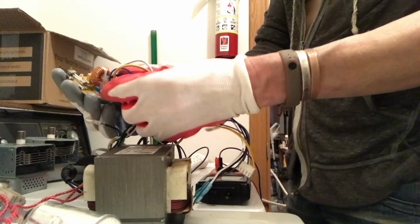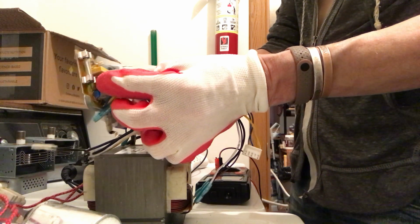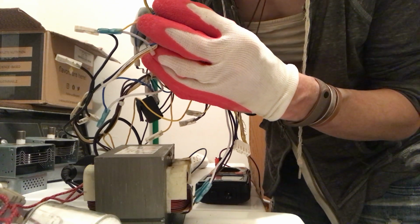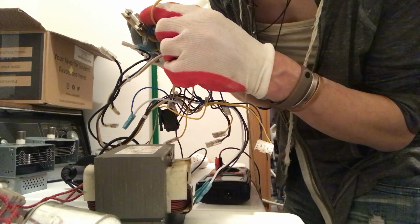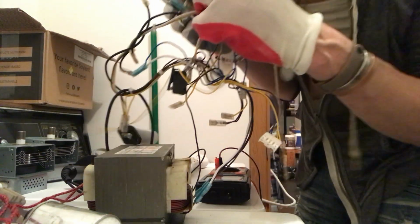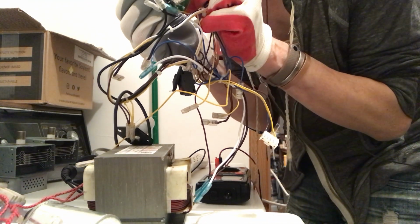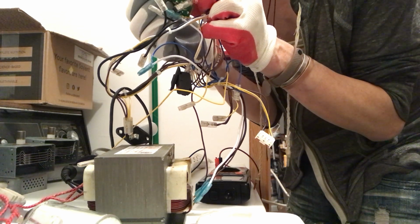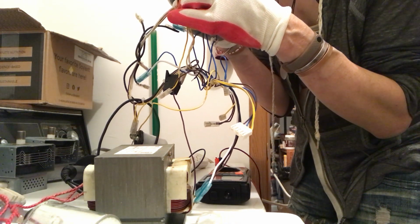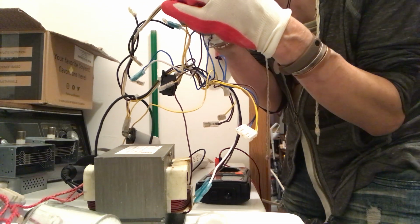And then here we have the fuse, a capacitor, an inductor, a film capacitor, and an R1, which I'm guessing is really low. It looks like a half watt resistor, and it's green, brown, yellow, and the tolerance is gold. Wow. Okay, and then the capacitor is 0.1 microfarad, 250 volts. Oh, that is AC, it has the little squiggle.